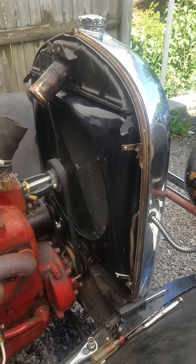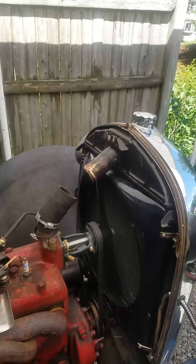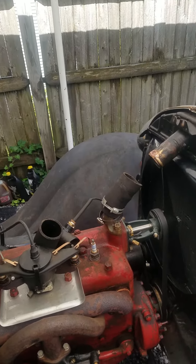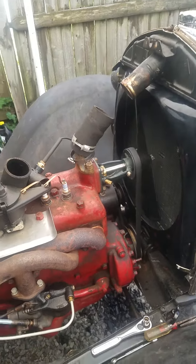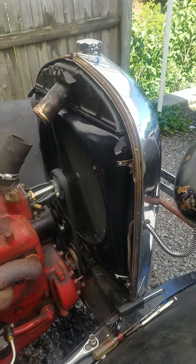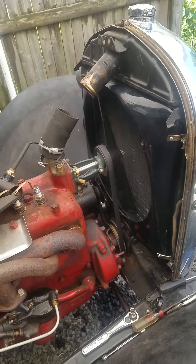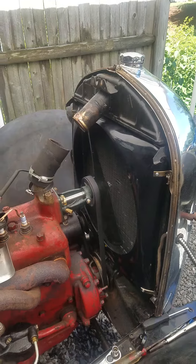I was missing one little nut — I don't know if it fell through the packaging or what. To get this thing in, I had to take the radiator support rods off, obviously the hood, and the upper radiator hose so I could tilt the radiator back to the light bar in order to sneak this in.